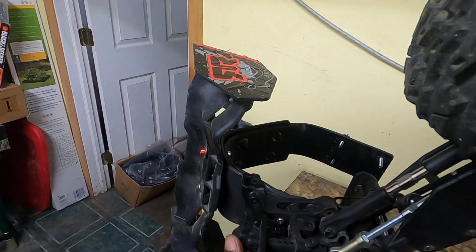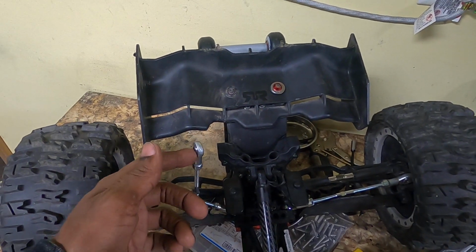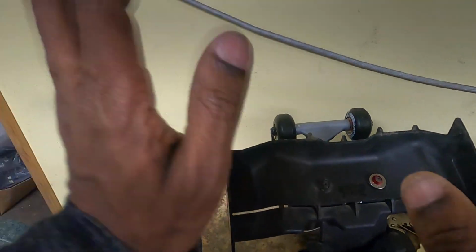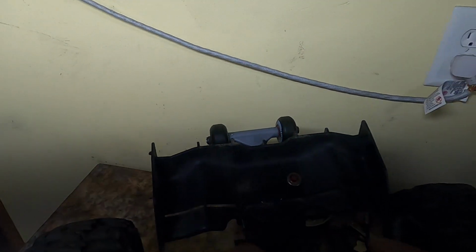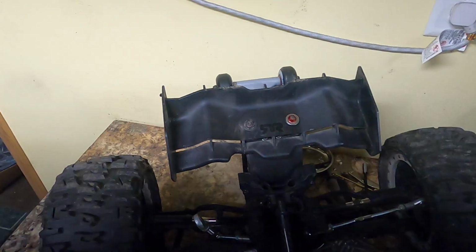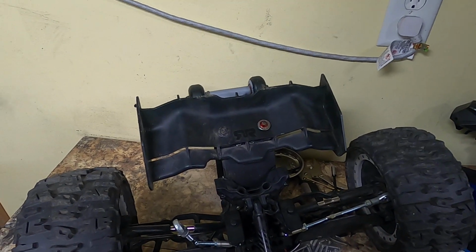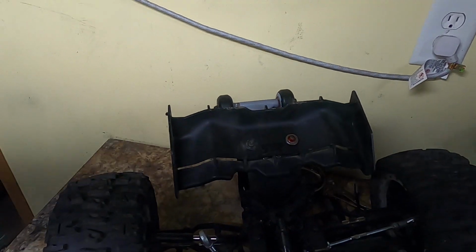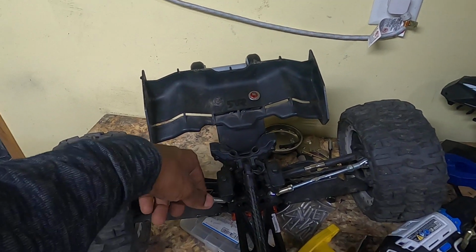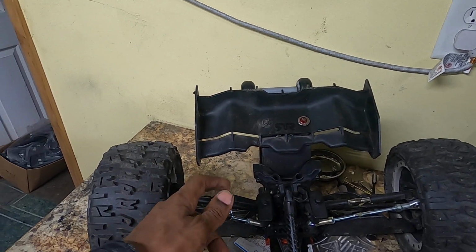But obviously, setups that you've never taken out before are always going to have a weak link. Okay, I'm done. No more puns. Okay, Willy bar 1, EXB 1, shock 0. But if the weakness on all the shocks is going to be the end, this ain't bending, this ain't breaking. Put a steel rod end on it and call it a day. So I will go that direction and wait for all the parts to come, because I didn't order them already.